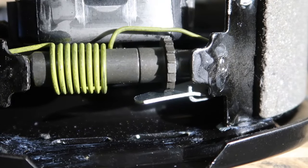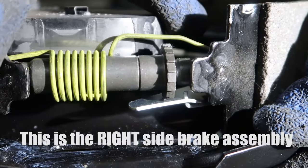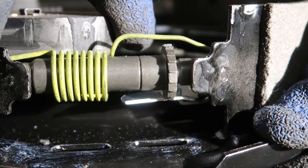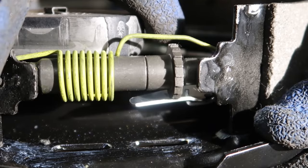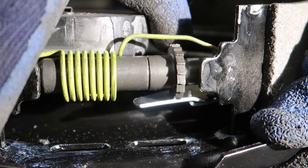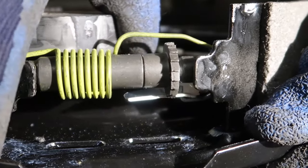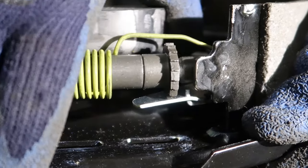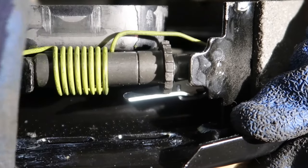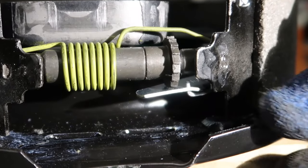Here's another example of showing this in operation. It clicked — that means the little arm engaged on the next higher tooth, and as the brakes release it spins the little star wheel. As I move this magnet with my hand, it's an exaggerated motion of the arm and the star wheel. In other words, every time you apply the brakes, that magnet is not going to move enough to cause the star wheel to rotate. Pretty nice setup, and this will definitely solve my problem.